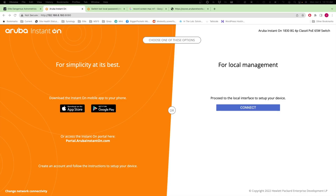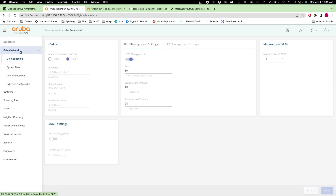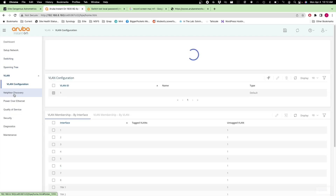If you're looking for app control but still locally controlled, you can go to Ubiquiti or TP-Link, which have near-identical options to each other. I just find the hardware and software is better with the Aruba line. If you don't want to use the app, once the switch is green, go to your router and find the IP address of the switch — it will take you to the start page where you can choose between easy mode with the app or local management. If you select local control, the switch is only accessible locally but you get more options. You can switch between the app and local control, but remember you will lose all your settings when you reset the switch.